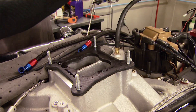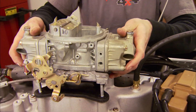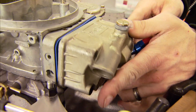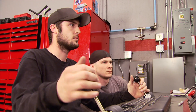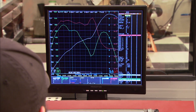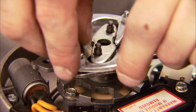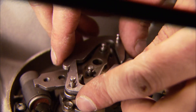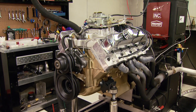We'll swap out the carb — while the Summit 750 is good, it's just not big enough for this motor. On went a Holley 870 Street Avenger, and we were ready for another pull: 376 horsepower, though torque came down. Running lean, so time for bigger jets. Chaos in the graph points to the distributor — the bushing was so tight against the weights that it was sticking shut, and as it went through the RPM range it wasn't advancing properly. After the fix: 525 foot-pounds and 437 horsepower.